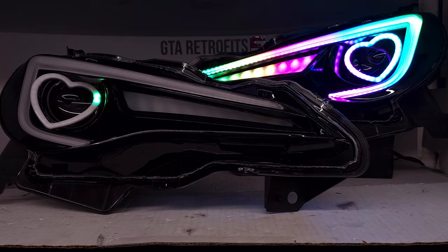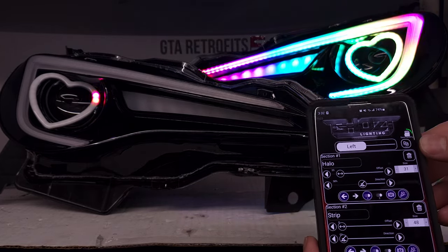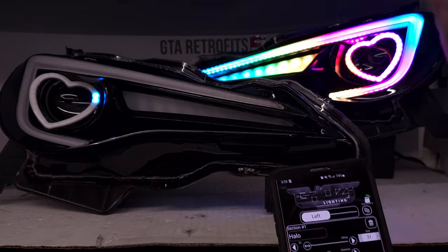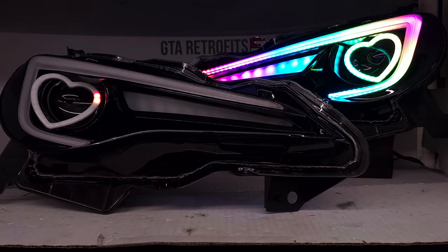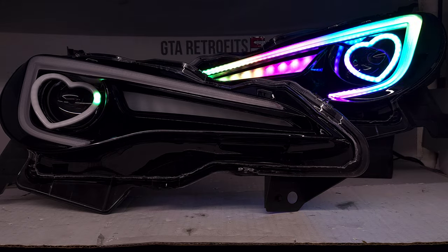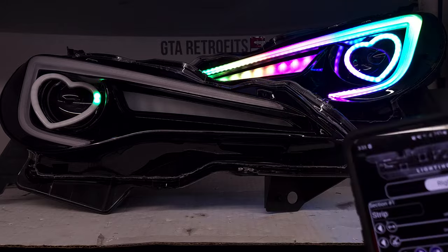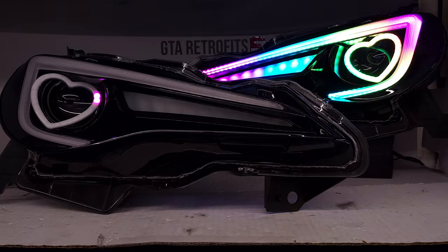So there's that — there's show modes. Now, the Blue Ghost controller has a function called copy, right here, where you can save all of this and put it on the other side. However, unfortunately right now — this is February 2023 — there is a little bug in that the turn signals do not work correctly if you do that. So we have to manually put all the information over to the right side. I'm going to pause the video, do that, and come back.